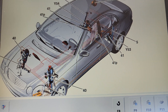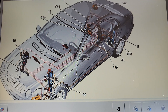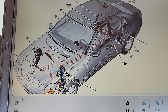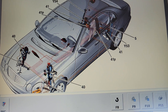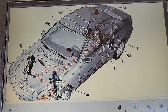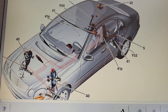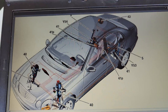That is the Mercedes Airmatic system according to me — speaking from experience, not technician training. I have the tools and the experience with this car. The main lesson: air leaks will get you every time. If you keep letting it leak, you'll eventually kill the rear air springs — they get pinched and they're done. So fix your air leaks, and don't be like me — I'm on my third set. Hope you enjoyed the Mercedes tech talk on the Airmatic system. Good day.